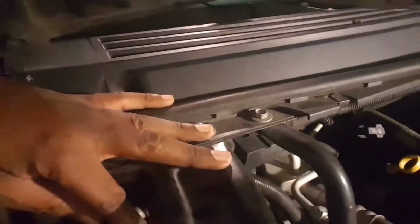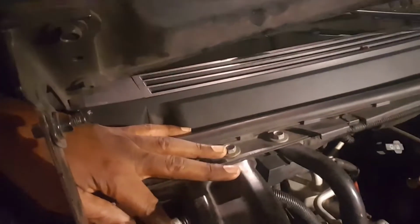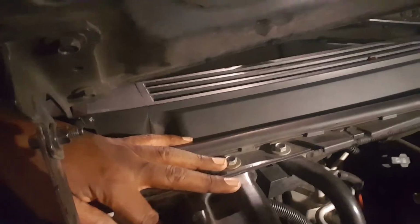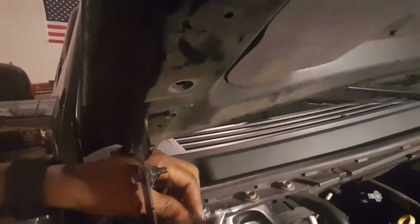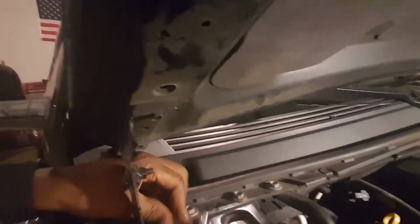So whenever you're disconnecting the battery, always take loose, look at me, always take loose the negative battery cable, okay? And that's what I'm going to do now. The nut on that is about a 10 millimeter, so I went and got a 10 millimeter socket, and I'm disconnecting. And you notice I'm disconnecting it, but I'm also hitting the body of the vehicle as I'm doing it. See, no arcs whatsoever, because I'm working with the negative cable.